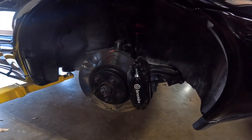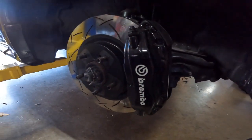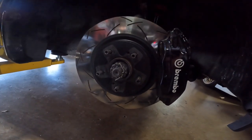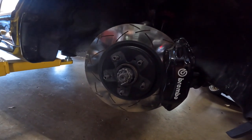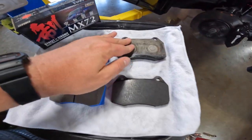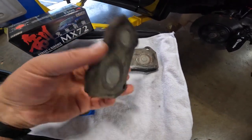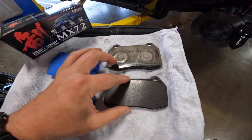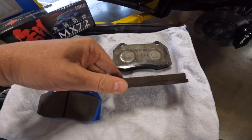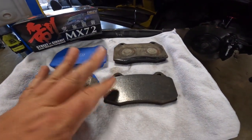The wheel is off, and if you remember from the earlier videos, we use a Brembo R33 GTR caliper front and rear — it's a bit of an upgrade from the stock Sumitomo ones. These are the rotors from DBA. These are the pads that just came off — these are a stock factory R33 pad, just what they come with. When I bought the calipers they had really nice fresh pads on it, but switching over because the OEM ones are cooked and glazed.